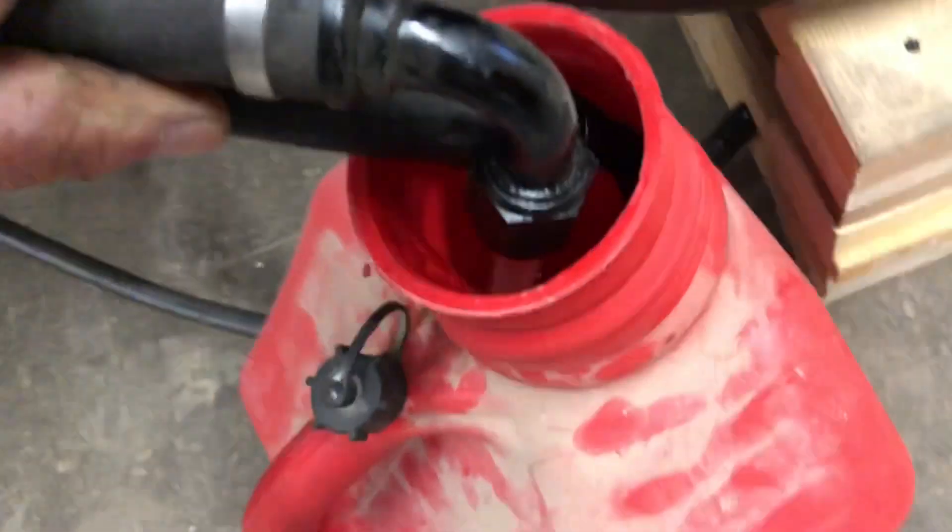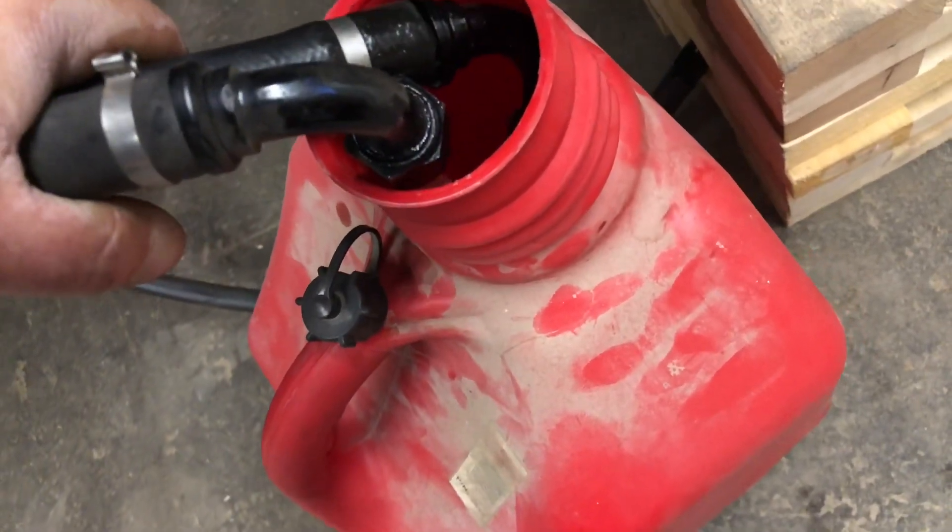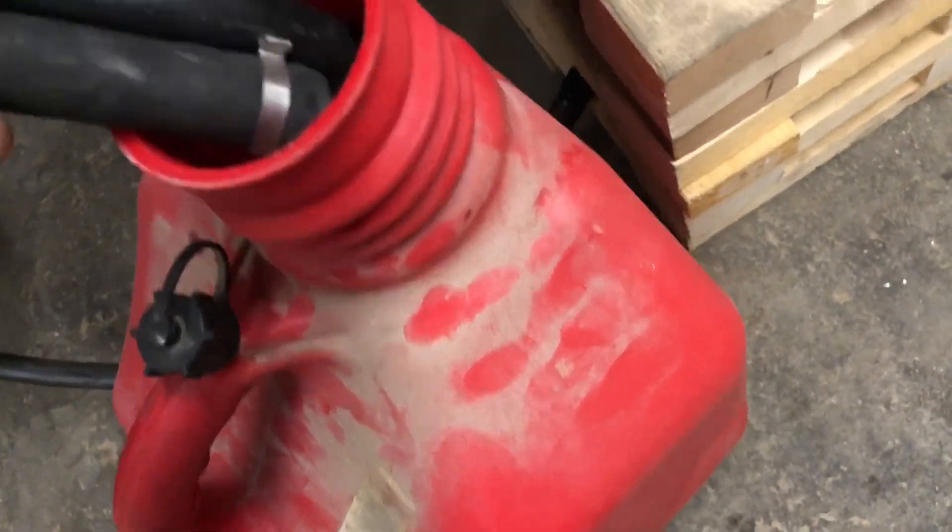It works great! Pumping stuff everywhere — both lines, just pumping away. Okay, that worked. I'll let y'all in on a little secret — something else I'm probably gonna do. I'm probably gonna fill my tank up with diesel and pump diesel through it, tie one of my supply lines to my return line, one line into the tank so it can regurgitate all the diesel through there. Diesel is petroleum based, more oily than gas. I feel like it'll lube everything up, probably make everything somewhat pliable again. I've got a ton of diesel around here, so why not use it?